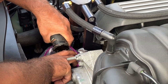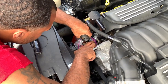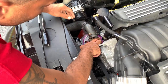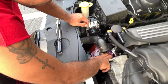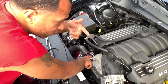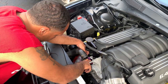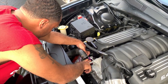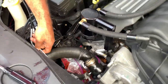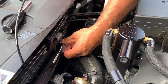Not too bad. Let's give it a second for it to drain out. It's not going to empty out your entire coolant, but it's good to try to catch most of it so you don't make a mess. Also, you can actually reuse that coolant and put it back into your reservoir. Now we're going to take off the next clamp. This tool comes in handy — you don't have to get crazy with pliers or channel locks. Just slide this on there, boom.